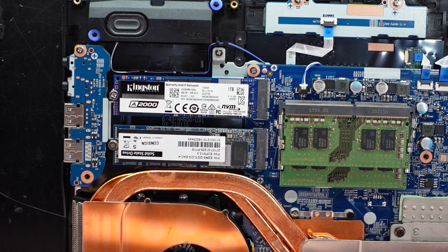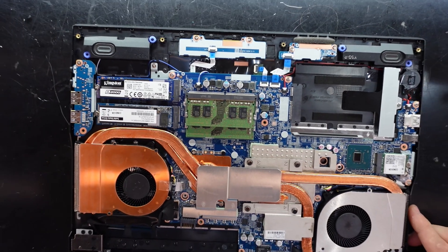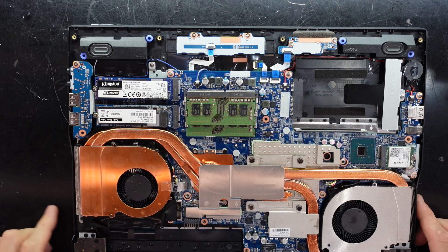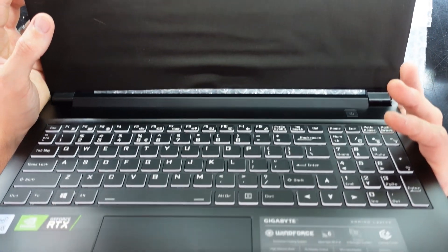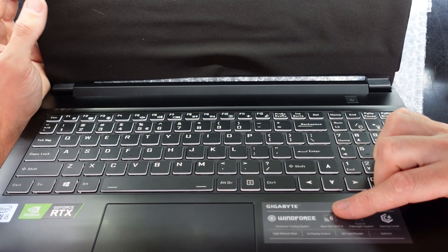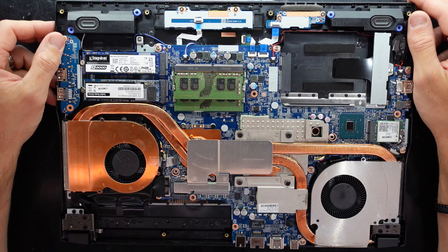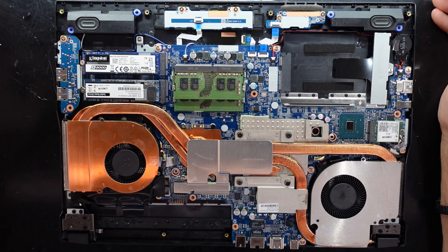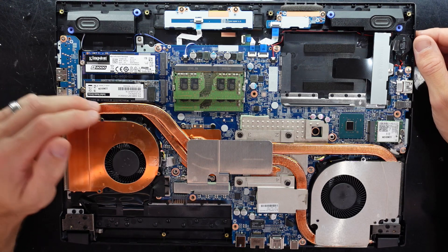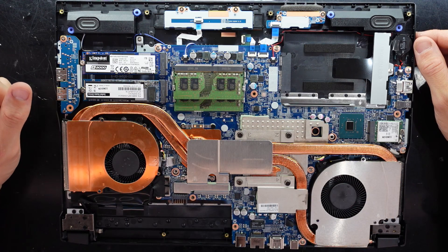One thing I'm getting the feeling of with this machine is that even though it's a Gigabyte brand, I'm extremely confident this would also be known as a Metabox, or a Clevo, or a Tongfang chassis, which has purely been stamped with Gigabyte on there. The biggest thing I don't actually like is essentially the false advertising. Looking down here we have 'Windforce exclusive cooling system' - I'd almost be willing to bet if we opened up a Clevo machine we'd see this exact same cooling system. It does not look like any form of proprietary or exclusive cooler. We've pretty much only got two copper pipes - one barely touching the GPU and two going over to the CPU. The design is not really that unique.